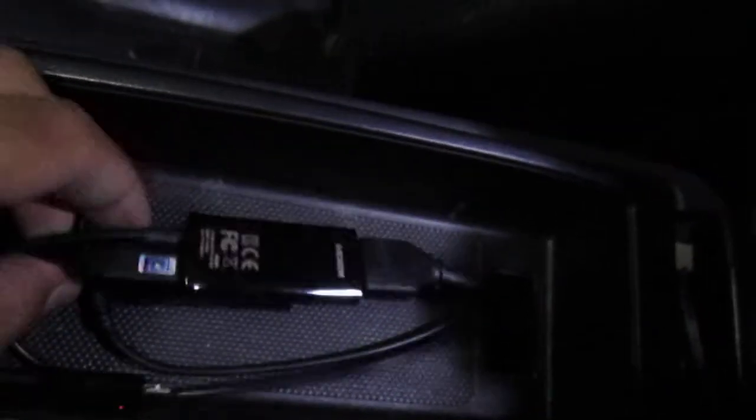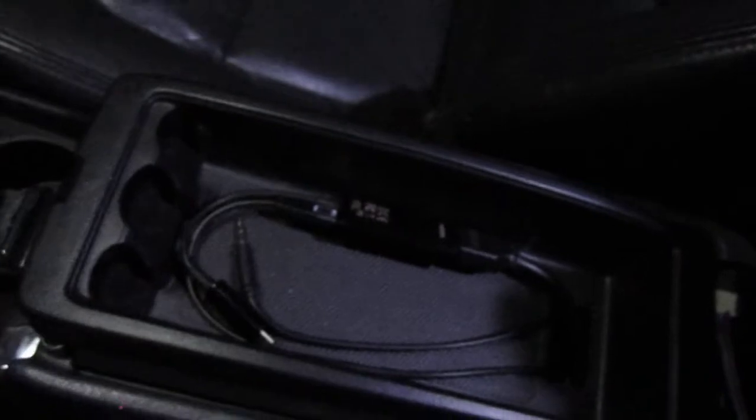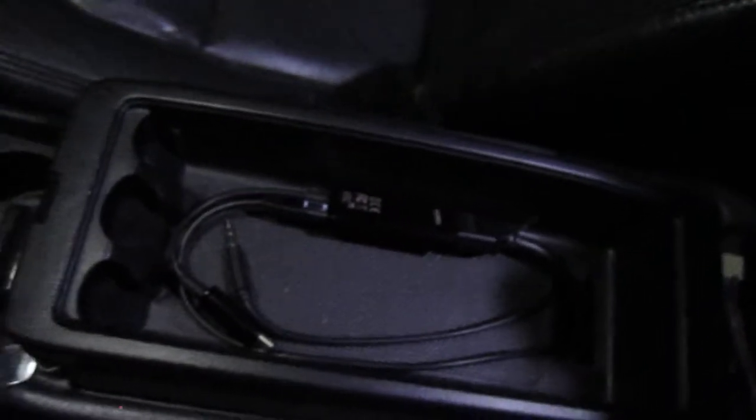I have my HDMI cable plugged in and a cell phone charger wired in here. This app, AR Liberator, is still a bit glitchy, and I found it works best if you plug in your phone to the adapter before you start your car. Because when you start up your car and the deck boots up, it's going to try to initialize that Bluetooth connection on the first try, and for some reason having it plugged in beforehand just works better.